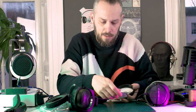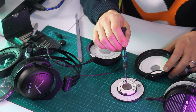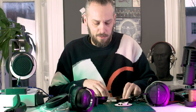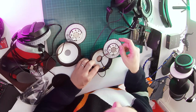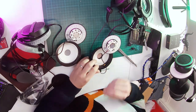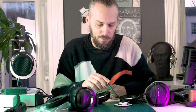Inside your standard 990s, that's the back of the driver — the magnet section is open, which is closed on the 770s and 880s. Inside you've got some damping material and a small hole in the middle, which is also partially blocked. So they say they're open but they're kind of semi-open. The Tiger has a similar arrangement by the look of it. The driver design is the same — other than being a different impedance. These are going to be 250 ohms, these ones are 32 ohms, as it says on the back of the driver. So drivers are pretty much the same, just a different impedance. If you wind the voice coil differently it's going to sound different, but the actual construction is the same.